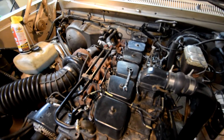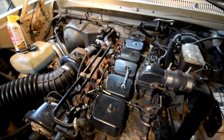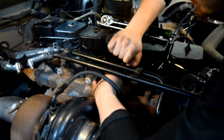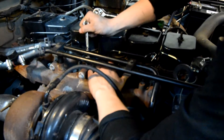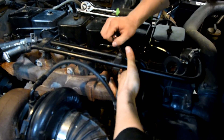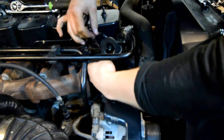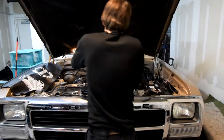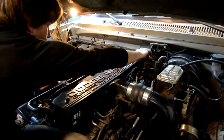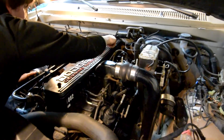That's on there. Now undo the protective cap and install the fuel line, putting the 10mm bolt back on. Tighten up the 10mm bolts — just nice and snug, not going crazy. Job well done. Let's start it up.